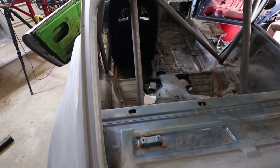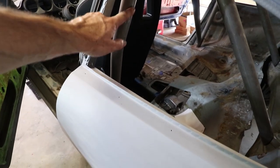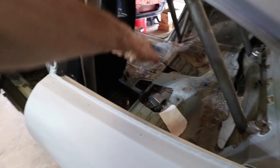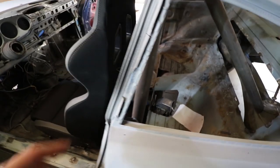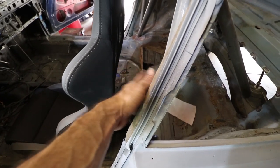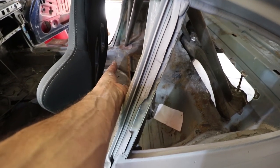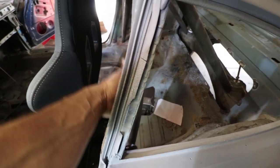So the other option is to maybe put a different harness bar in. I could attach the harness bar to the main hoop and locate it with a bend that goes about here. So that would give me enough distance between the seat and the main hoop so that there's some hardware. If the straps loop around, there's a clasp and stuff here in the middle. So you can't have the harness bar directly behind the seat. It's got to have some distance behind it.